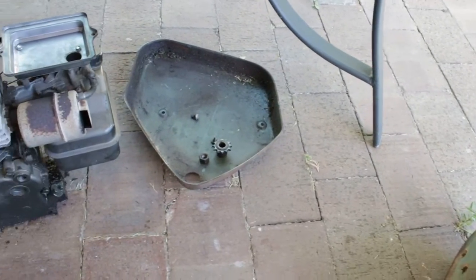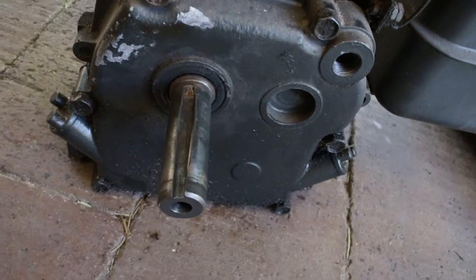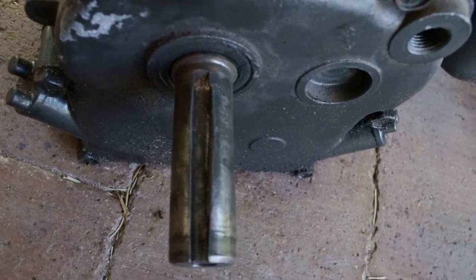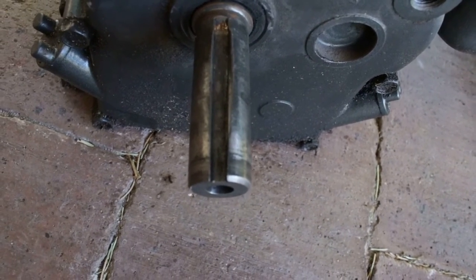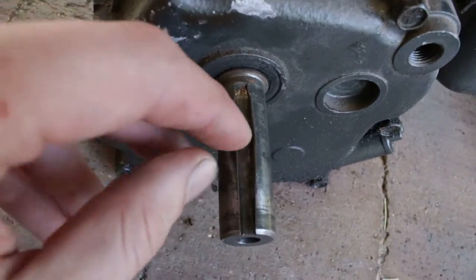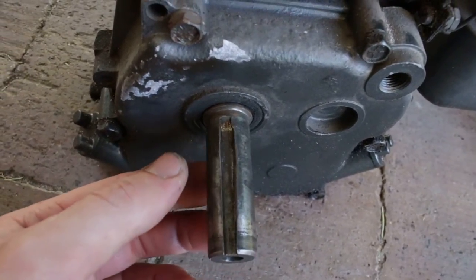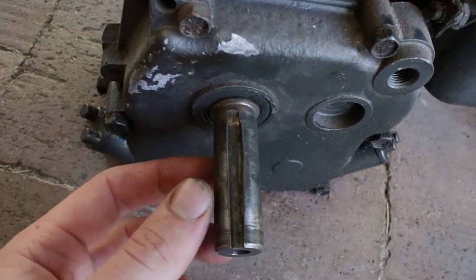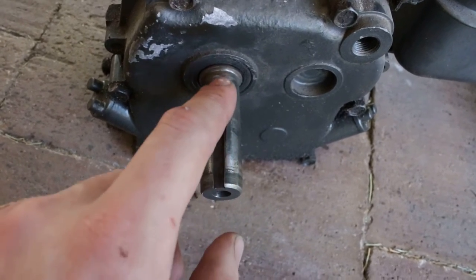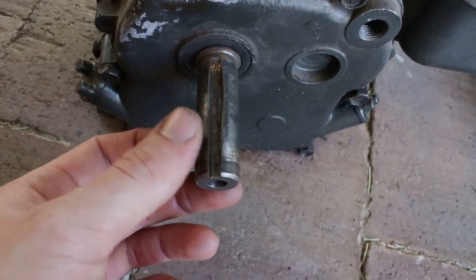If we go over to the engine now, the key on the engine is not looking too happy as you can see. It's a bit worn - the very side of the keyway isn't too bad, the very end isn't too bad, but the middle section is quite worn. Obviously without pulling the entire engine apart and changing the crank, this is kind of not quite repairable as-is.